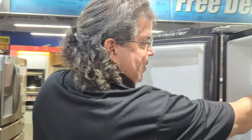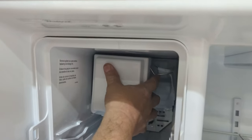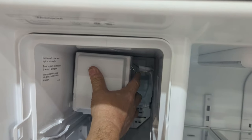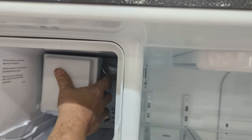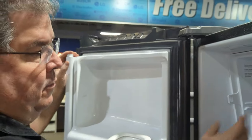What you also want to look for is this little bar here. If this is stuck up, that means your ice machine is shut off. So you want to find out what's holding that up. If that's stuck up, you're not going to make any ice, even if it is a proper temperature.